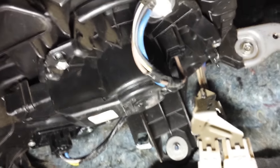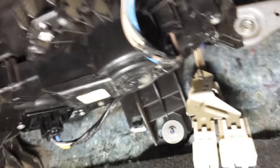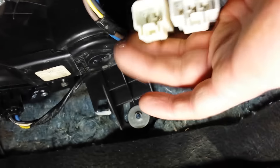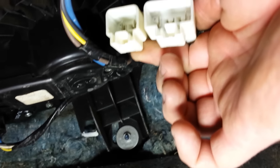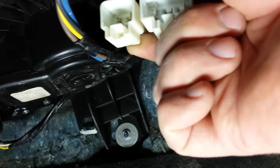If you want to take it all the way out and replace it, you'd be cutting that zip tie off. Reverse process: put the motor back up with the three 8mm bolts and two connectors. The resistor is one extra screw — I removed it just to get it out of the way. Then throw the glove box back in and cross your fingers you get no more mouse.